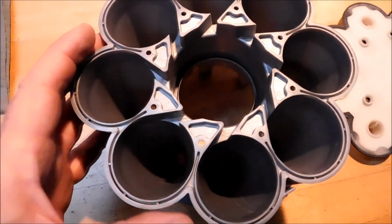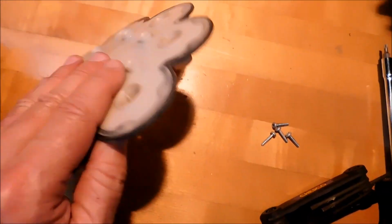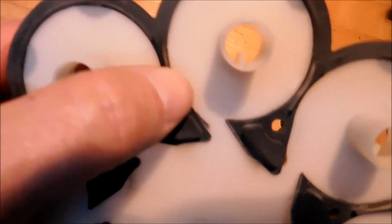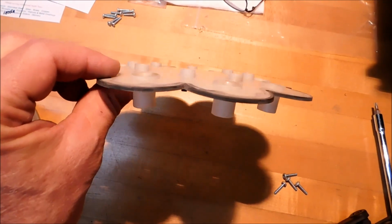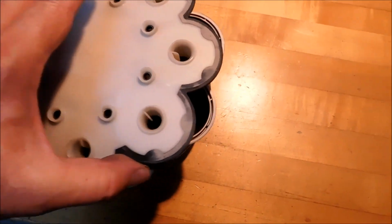Locate these next two pieces. Make sure that all these grooves are clean, because that is a sealing area. The underside of this has the elevated lip that goes down in there. And you want to make sure that that fits in there nice and snug. This is domed, as you can see, convex, concave, depending on which side you're looking at. Make sure the correct side is down. These tips, they go down, so stick it on there.